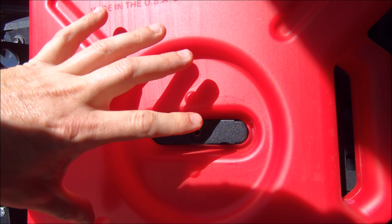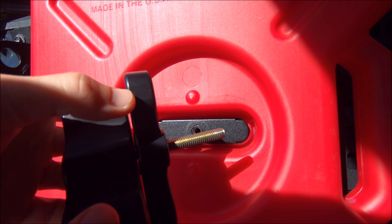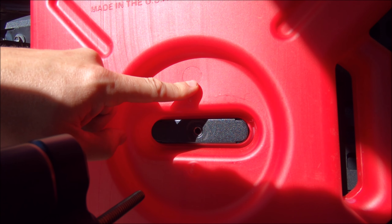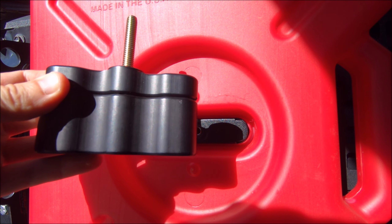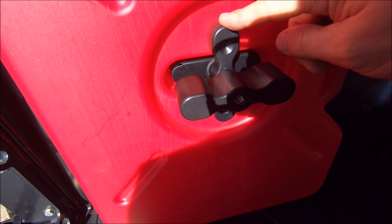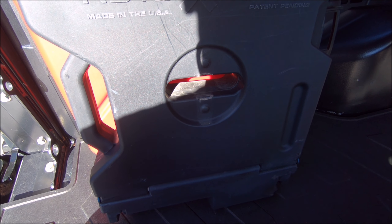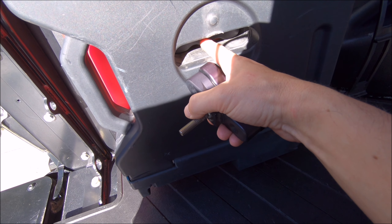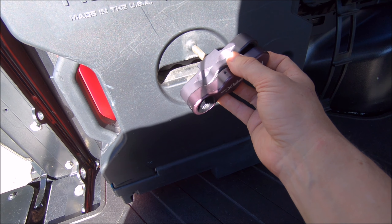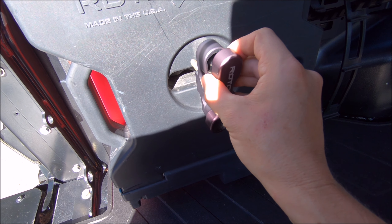With the base platform for my Rotopax fuel packs, I'm going to take the new extension and mount it perpendicularly. There's a small piece that spins freely with two notches on the back — make sure those are lined up with the notches to hold it in place. I'll put a link for this in the description below. Mount it so the smaller piece is perpendicular and the other is on the same plane, because the slot on the dry storage Rotopax is horizontal not vertical. Then slide both pieces through, make sure it goes over the two mounts to hold it secure — this entire thing goes on perpendicularly, and this is the one that locks.